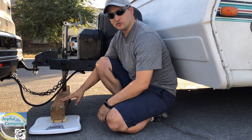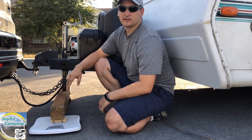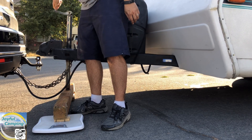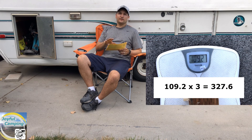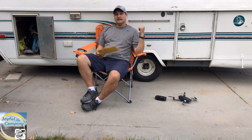We've got the setup here for the contraption to measure tongue weight. All I'm going to do is lower the trailer down onto it, get a reading from the scale, do a little bit of math, and I'll know exactly what the tongue weight is. The scale reads 109. That comes in at roughly 330 pounds — I took the weight on the scale and multiplied it by three, based on how the board is set up and where it lands on the scale. I'll link that video in the description so you can make your own. It's all about making sure you're safe while towing: well within the 10 to 15% range, and below whatever the ball rating is on your hitch.